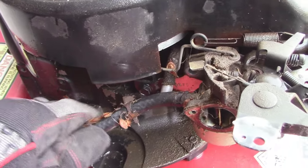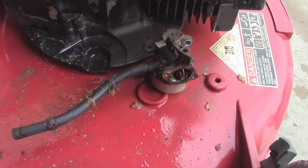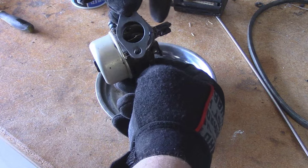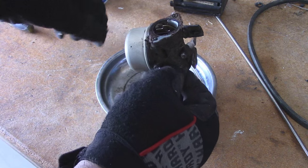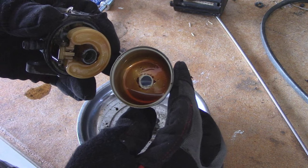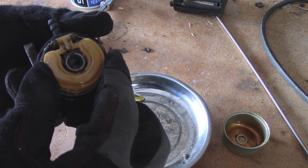Now that those are out and I already removed this bolt down here, I just have to remove these top three around the top here. I also removed that side of the fuel line. All we have to do is pull it off and kind of angle it out of that linkage right there. There you have it — so let's go ahead and take it apart and remove that line. We have the carburetor as you guys can see. I do have gaskets for this thing — it takes the old style. And it is in very bad condition. I managed to separate the bowl and yep, that's why it wasn't running. Dirty, nasty old fuel — looks like maple syrup. Doesn't smell as good though.